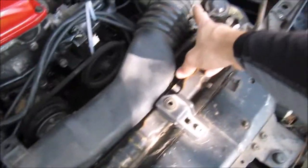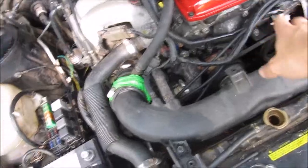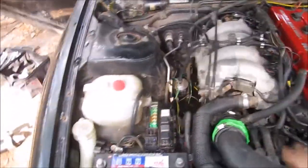Now I just need to top off the radiator with some water, get some of these things connected, like this clamp right here, tighten back up, this clamp tighten back up, make sure none of the lines or wires or anything are in the way, and then at that point I can go ahead and reconnect the battery and try and start it. Getting so close. So let's get to that radiator and finish up these last two things right here, and then try and start her.